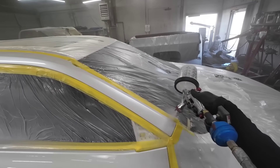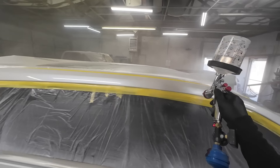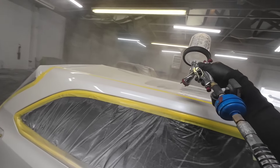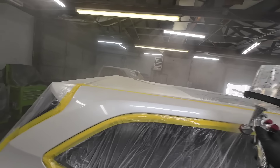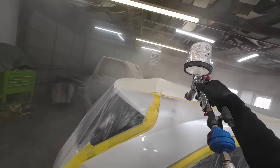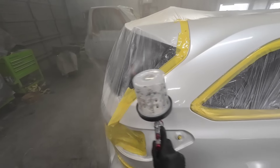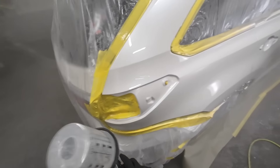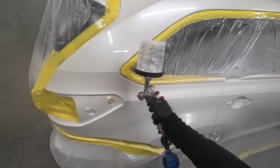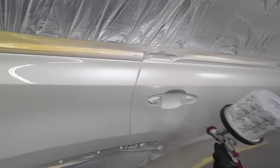Check out the clear after the first coat — slicked out beautifully. I'm ready to lay on the second coat, hit it a little bit harder, get it a little slicker, put more material on the panel, let it flow out just a little bit better. Now if you like to paint quickly and think a low volume, low pressure gun is too slow, you can change your technique: move closer to the panel — about three inches away — and move quickly across it. You're getting more material on the panel and speeding up the gun. Just be careful — you have to be very consistent in your distance and speed at three inches, or you could run it. But this technique lets you spray it just like a conventional gun and still get the results you're looking for.